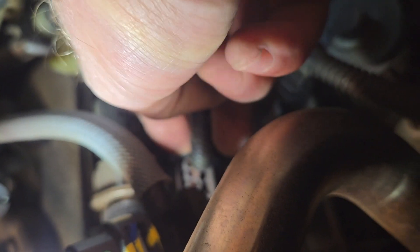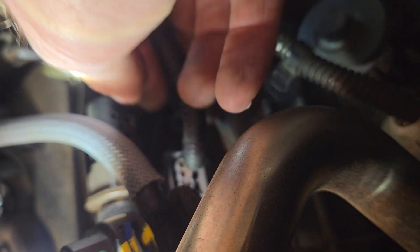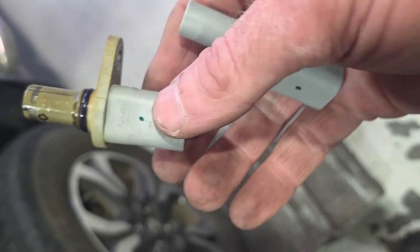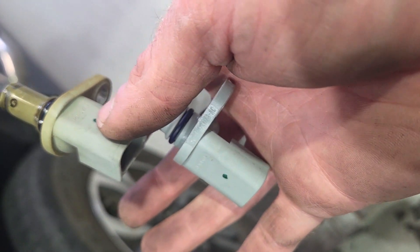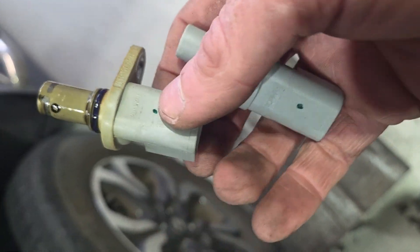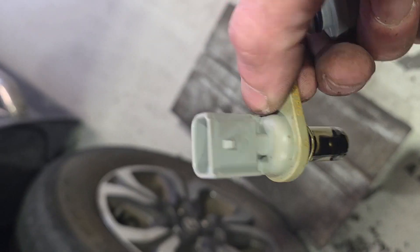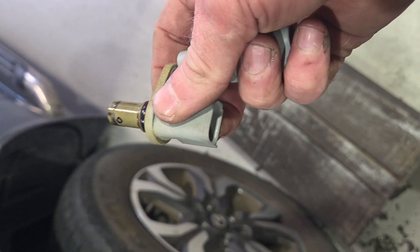And there — see the gray. There we are, old one out, new one to go in. Always recommend genuine parts for cam and crank sensors. The tab is on the bottom, so that's when you've got to push up the tab on the plug to release it.